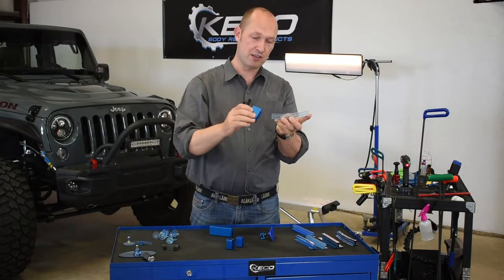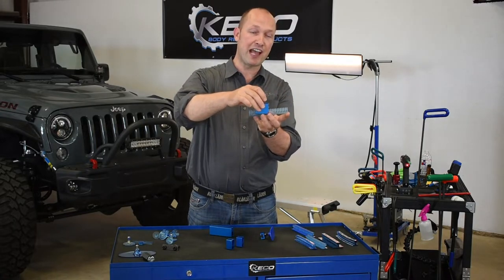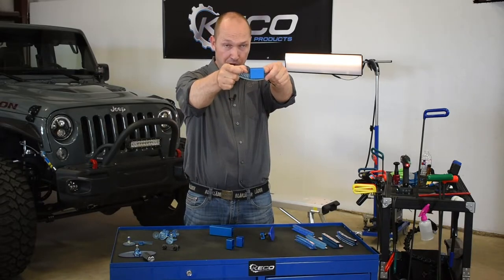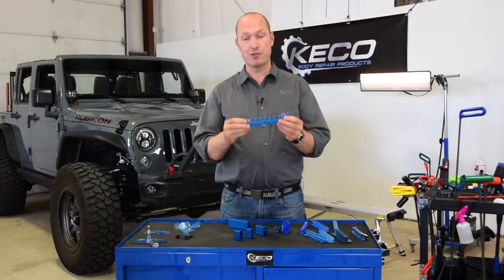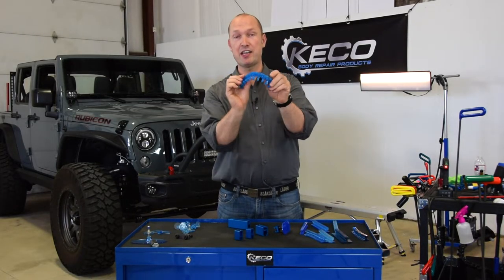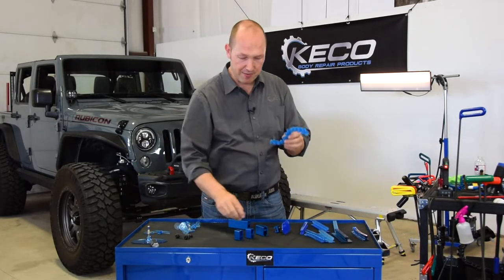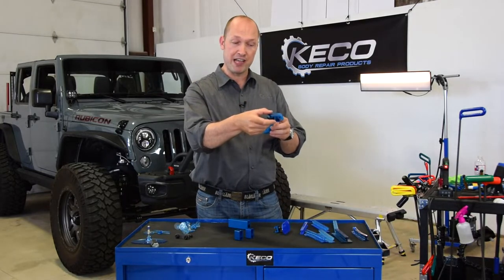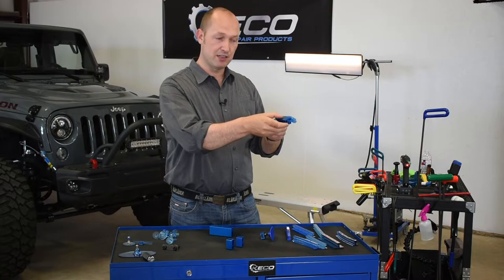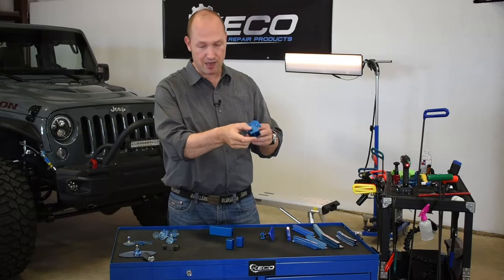That's when we use the 50mm one, which will be able to slide over the tab all the time — even if it's bent like this, you can still grab it and pull up the deepest point. Also for our new Viper tabs that follow your crease or your damage on your car, if it's a curved damage, you use a smaller adapter that will slide over it and follow the dent, and you can grab it and pull it with your K-Beam or your K-Bar and straighten out the dent.